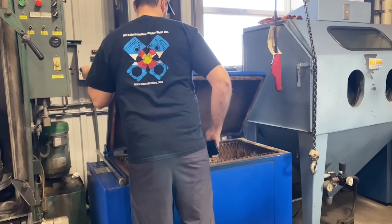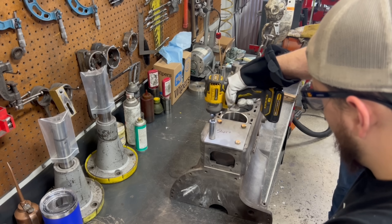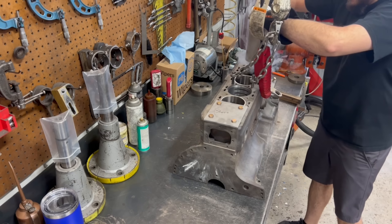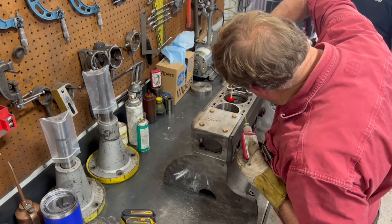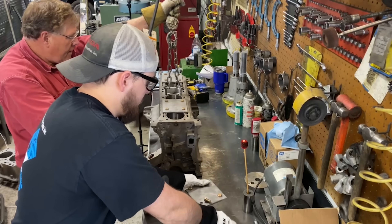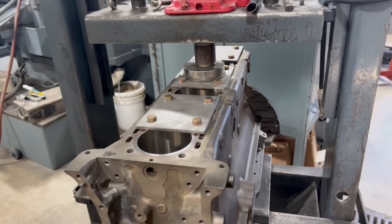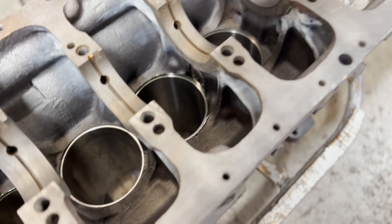Back into the oven we go. For installing the next three sleeves we decided to tweak our process just a little bit. On the first three the block held its temperature very well but the Loctite started to set up before we compressed the sleeves to seat them and torque our retaining plates. As such we decided that we would do the sleeves one at a time on these next three — coat the block with the Loctite, install the sleeve, and then move over to the press before coming back for the next sleeve. These are the types of things that you learn as you go and keep in mind for your next job. One would think that using temperature differential would allow you to avoid the press completely, but in fact you still have to use it to make sure the sleeve is fully seated against the counterbore. My dad and I were just focused on getting these sleeves installed safely and properly and the footage came second.